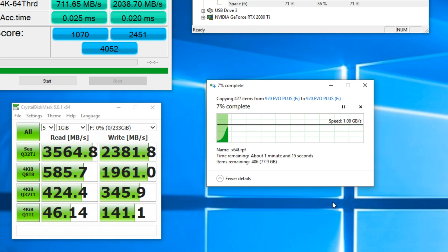You could probably call that false advertising, although that's a topic for another video. What's important to know is the sizes and performance you get when you drop off that cache, and when you will drop off. For the 250 gig model of the 970 EVO Plus, the cache is ridiculously small. Looking at my copy or duplication test, you have a very small amount of full-speed performance — only around one gigabyte per second as I'm duplicating files on the drive itself, stressing both reads and writes simultaneously. That immediately drops off down to its throttled level, which for the 250 gig version is only 400 megabytes per second at peak.